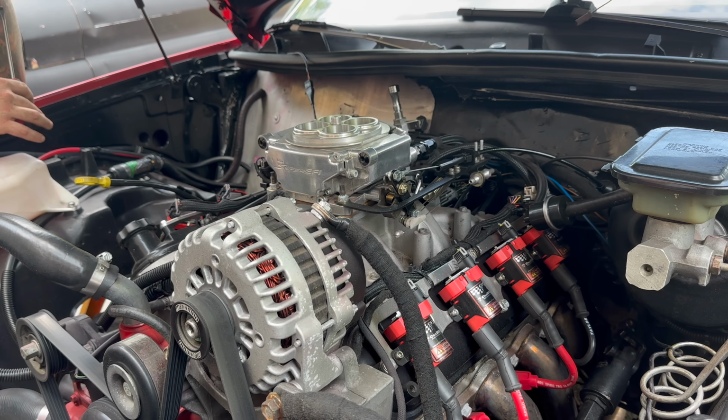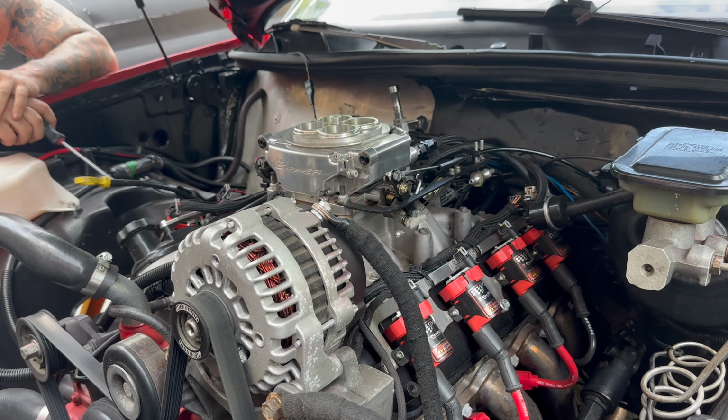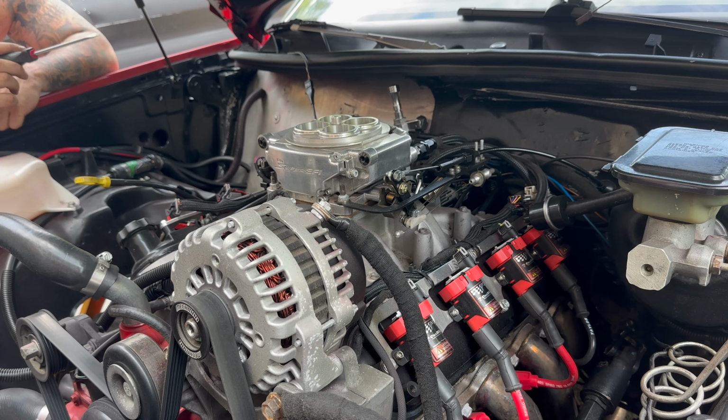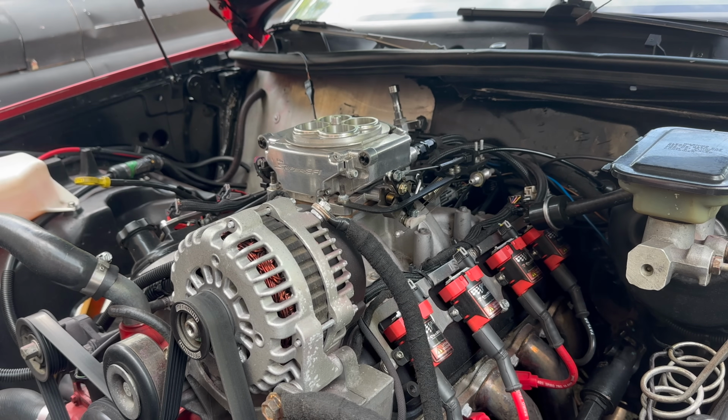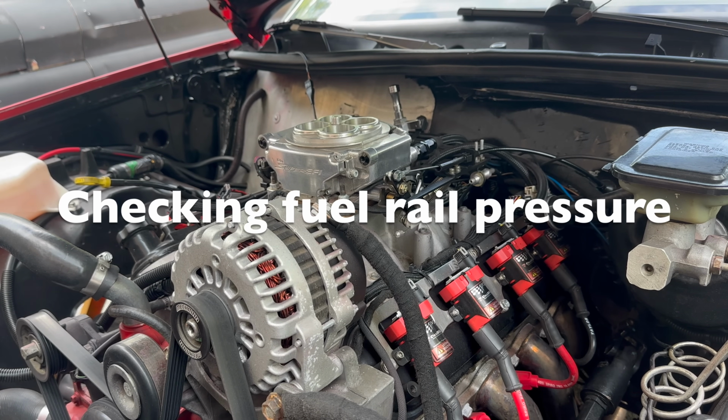It doesn't feel like a full electrical issue. To me, it feels like there's a plug that is arcing on the header. There's not. Or fuel based. Only other thing I know to do is pop that fitting off and put that setup back on it, and make sure we got 60 PSI. It's the only other thing I know to do.